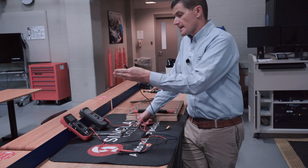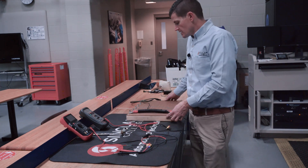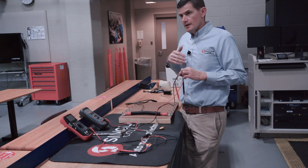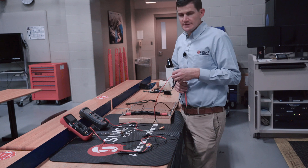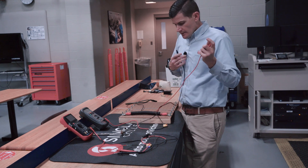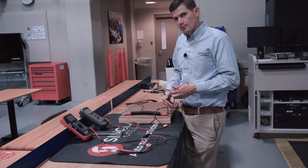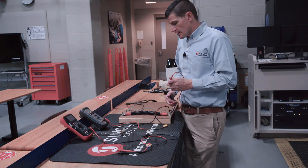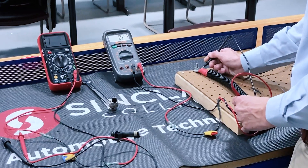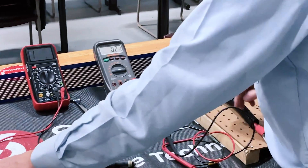The last thing I want to cover is the limitation of an ohmmeter. I'll often see in service manuals and service information instructions to check the resistance of a wire for unwanted or high resistance. You can do this if the wire is completely open. However, when checking for high resistance — for example, a wire that could be causing a voltage drop, which we've covered in another video — measuring 0.2 ohms might lead you to assume the circuit is good. Let's verify with the manual ranging meter on the 200 ohm scale.